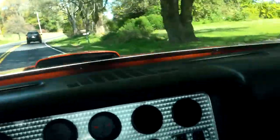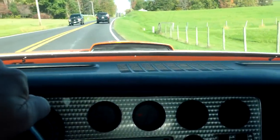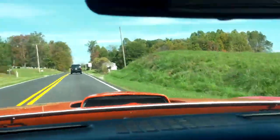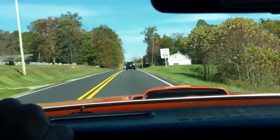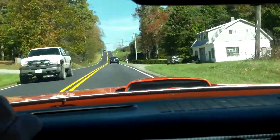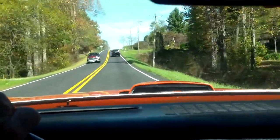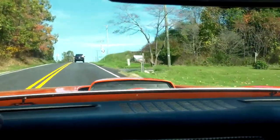And in addition to that, it's got a 4-speed overdrive automatic transmission. It's a 200-4R automatic. That's got a high stall torque converter and manual control valve body. So it shifts pretty aggressively too. But with the really steep overdrive gearing it's got, I'm going to show you here, it's going to get up into overdrive. Okay, now it just shifted into overdrive.